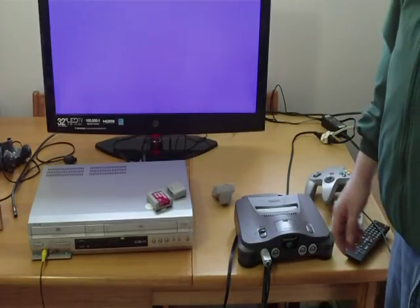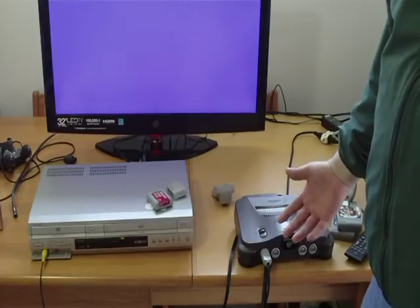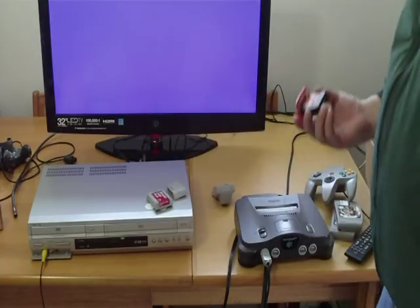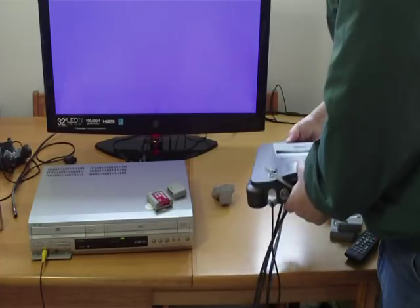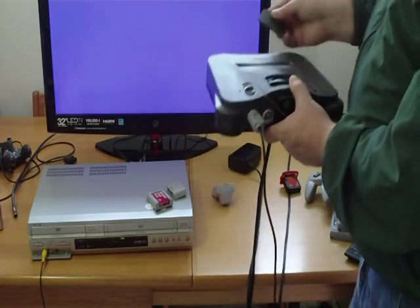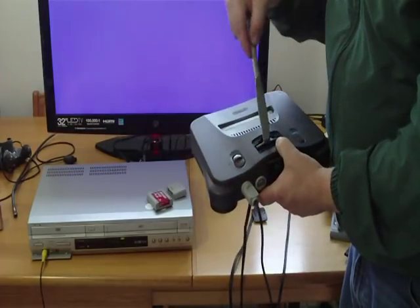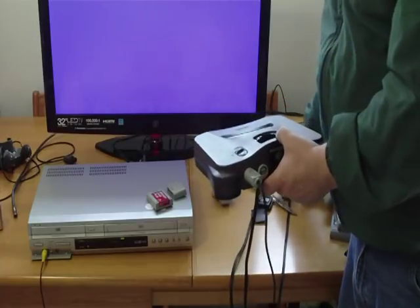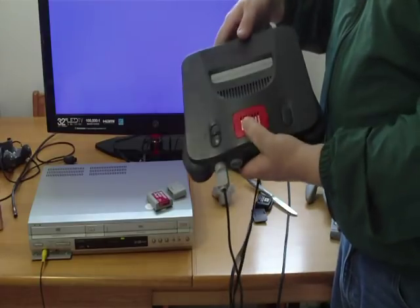The last thing to show you is how to change out your RAM expansion. For some of the more graphically engaging games, you need a RAM expander. This is an aftermarket one, but Nintendo has one too — either way you're getting the same thing. Make sure the power is off on the N64. Pull that out of there, take the top off, and I always use a butter knife, but the actual tool comes with it if you buy it brand new. Just slowly pry that out of there — easy. Put the new one in; these only go in one way so you can't really screw it up. Now you can play the more graphically advanced games on your N64.